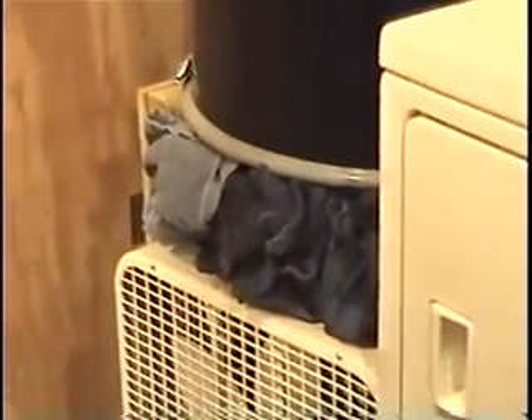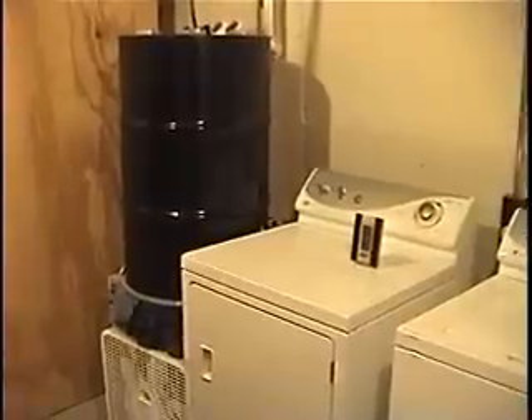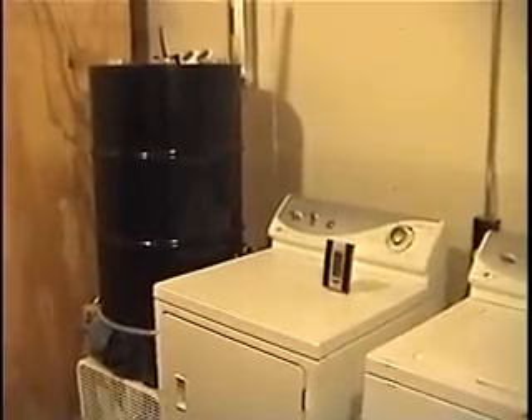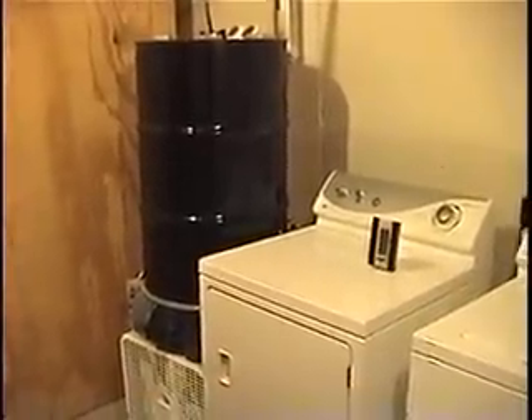Two more things I want to quickly mention: down there you can see a shirt and a towel that I have stuck to fill in the gap between the fan and the top of the drum. That is taking all the air from the fan and sending it through the tubes. I haven't noticed any problems at all with the dryer — no restricted exhaust, no burned-out heating elements. There is a little squeal from the idler pulley, but that has been there since we got the dryer brand new, so there have been no ill effects from running the heat exchanger.